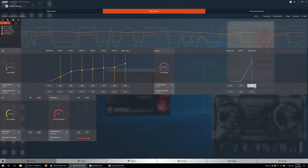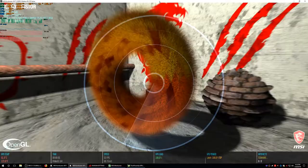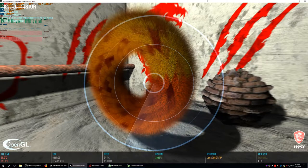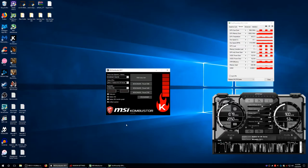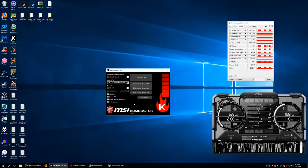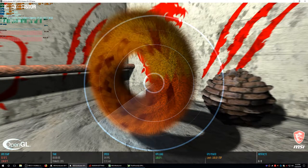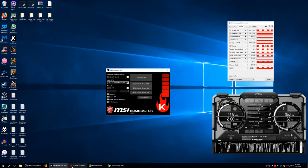Let's try 2050 MHz on combined. No artifacts right away. I did leave the millivolts on auto — I don't even think it lets me change it. Before at this clock speed, or even underclocked, I should be able to get as high as 2150 MHz. Let's try 2100 MHz. No artifacts right away.